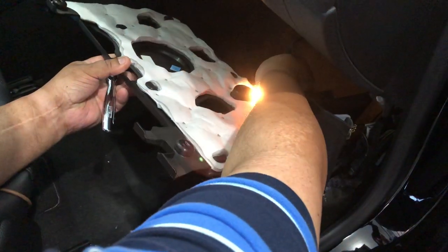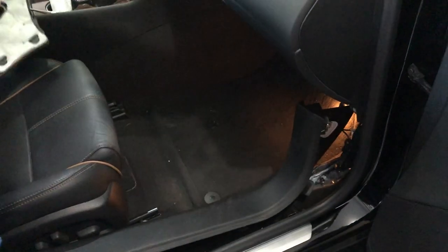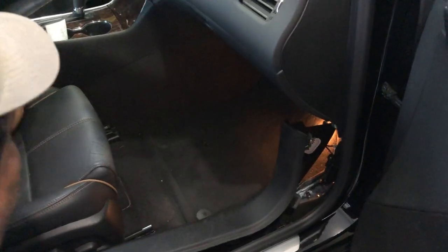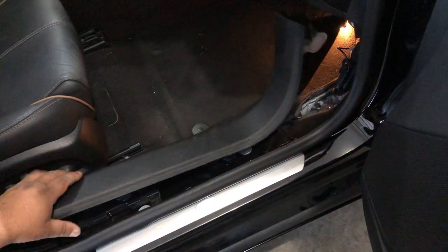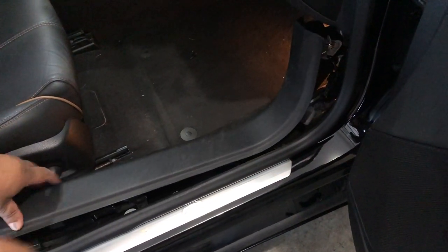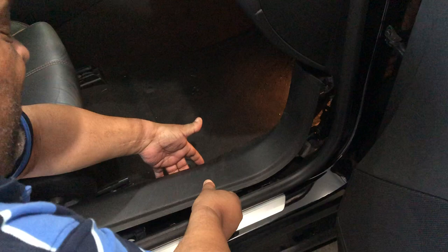Be very careful when you drop the second bolt that you don't break this cable. After that, you're going to take this threshold piece off. I advise starting from the back and just peeling it up. It's going to be really difficult and it's going to sound like you're breaking things, but don't freak out — it'll come out. Start from the back, and you might want to stand up when you get to the front, rocking it back and forth and prying more on this side.